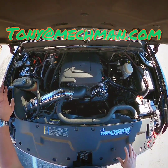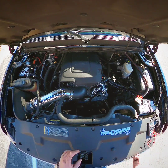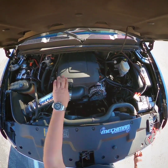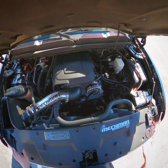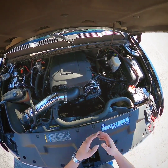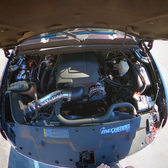Specifically, this will work for a single battery setup — this one's a dual. There's nothing special about it; it's a simple dual setup. I don't run an isolator because isolators have resistance in them and I don't like them. These are AGM batteries, 12-volt. It's a cookie-cutter 12-volt big alternator two-battery setup, so I can just go over some things real quick.